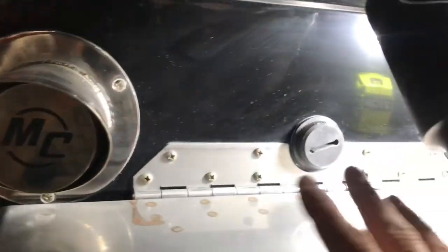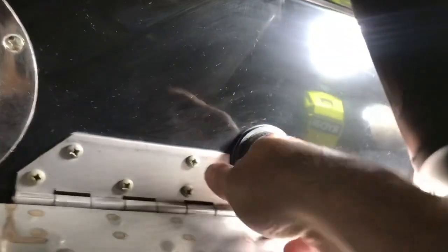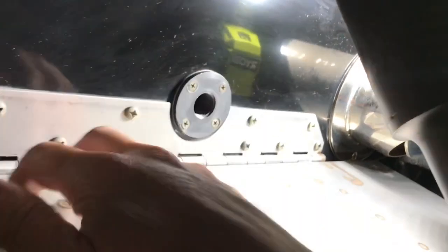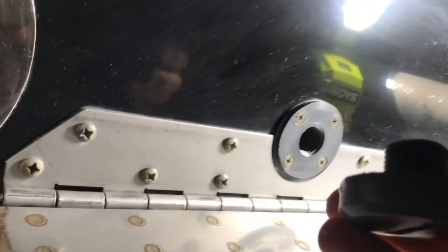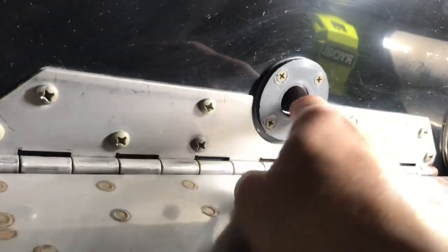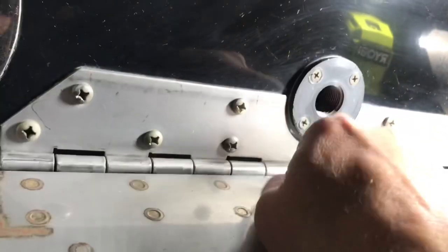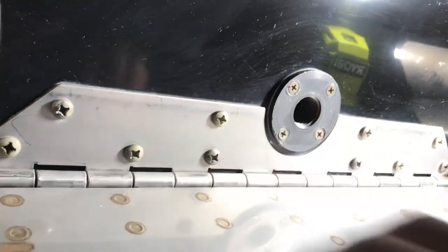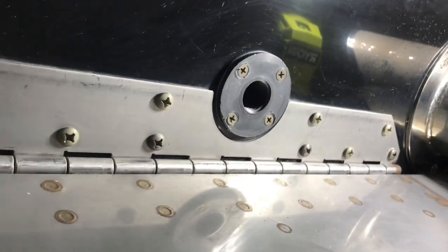This is the exhaust tips. This is the wake plate. Anyways, this is the rear drain plug. So what you want to do is get that loose. Okay, unscrew it. While you have that off, inspect your O-ring. Make sure the O-ring's good. There's an O-ring on that. Okay, so now I'm gonna snake that drain hose through here out the back, so that way it's down at a lower point than the drain pan.